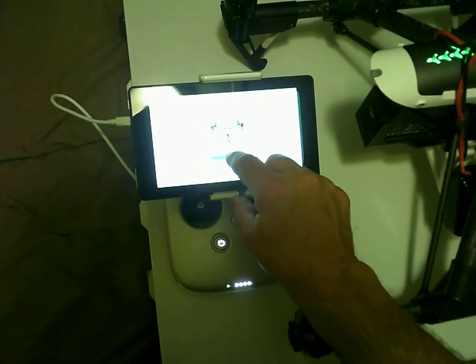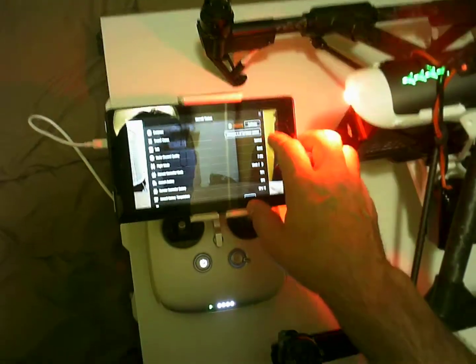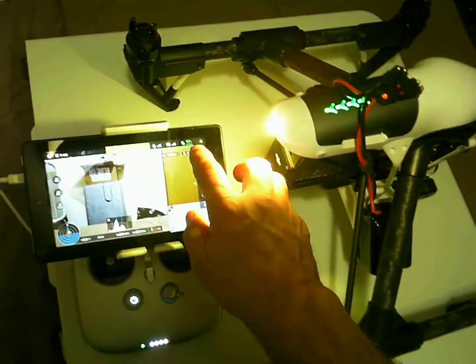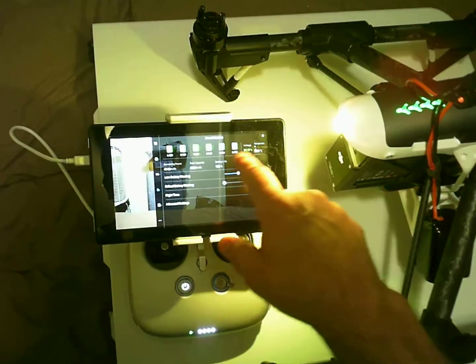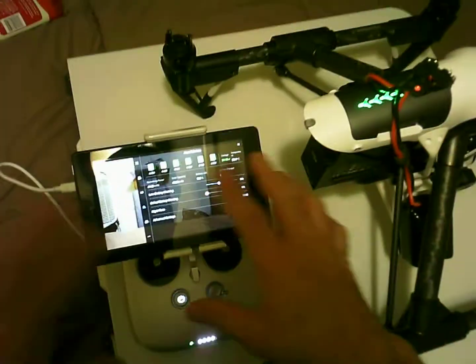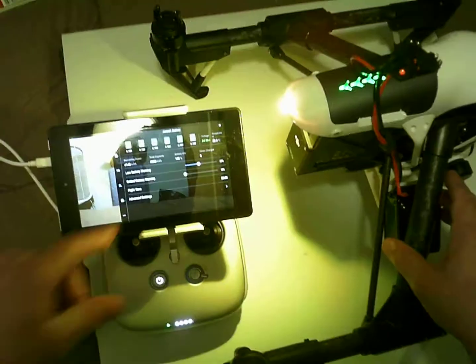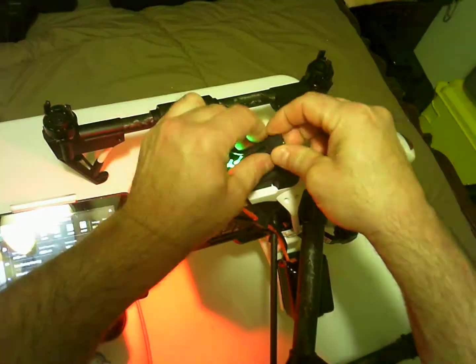I'm inside, so it's going to show some weird compass calibration issues. Even though that battery is brand new, it's only showing 92 percent — but that's the first charge it's ever had. It says battery life 100 percent. Now that everything is booted up, we'll look at the numbers: 2496-97, and the cells are at 4.16 volts. The key with these auxiliary packs is you've got to keep them lower than 4.16, otherwise they'll start charging the main battery.